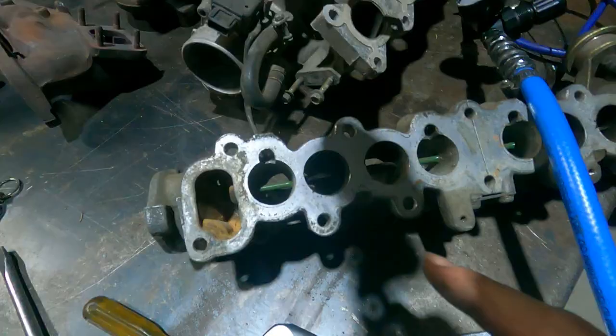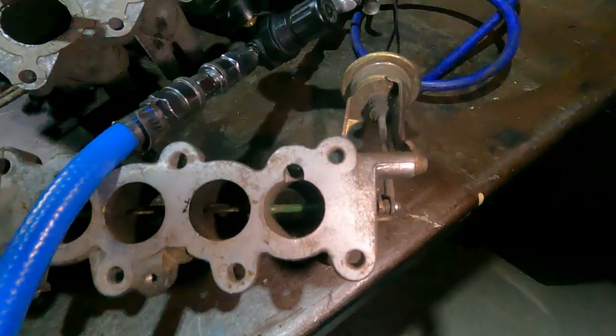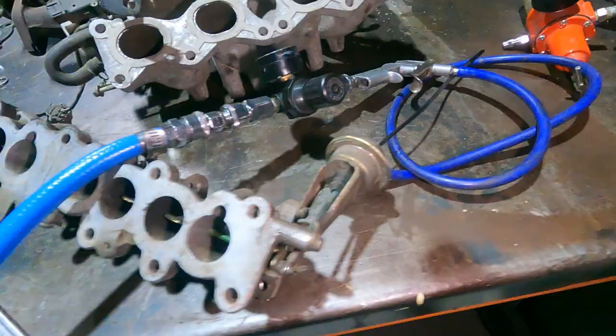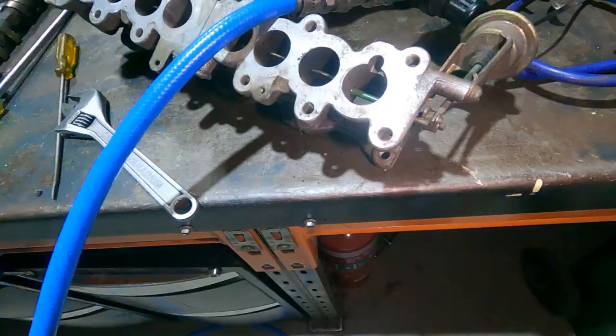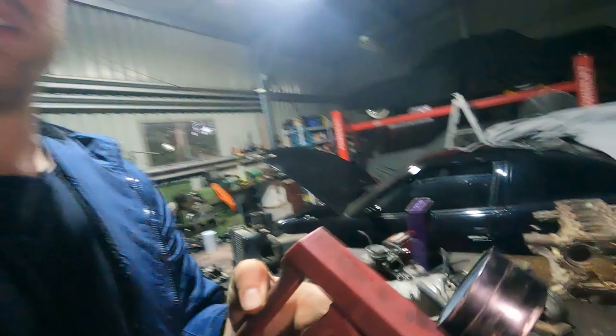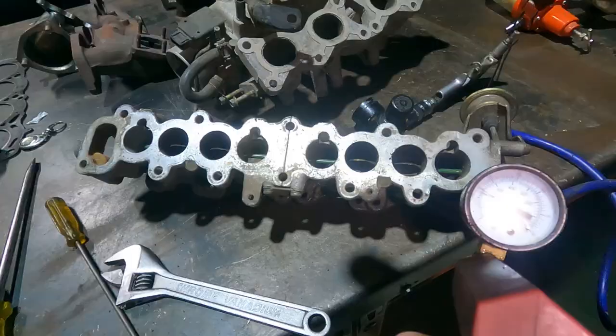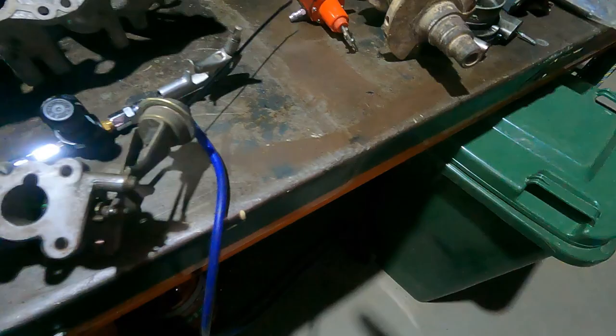First I just want to talk about how the intake manifold butterflies work on the car. The intake manifold butterflies under atmospheric conditions are already open. You can see inside there they're attached to this shaft which has an actuator on the end. I have 20 psi of pressure here just to demonstrate - when you apply pressure to the actuator there's no movement. Now I've got this vacuum brake bleeding gun hooked up and we're going to apply some vacuum to it. Start to pump and you can actually see the butterflies move. Now they're completely shut under vacuum, and when we release the vacuum you can see they're open.